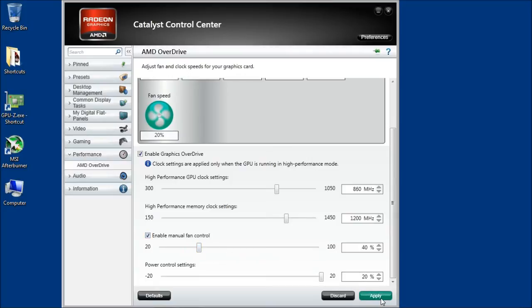The first thing we are going to do when overclocking is give more voltage through our power setting control, so the video card will be stable when adjusting GPU frequency and video memory frequency and will have enough voltage to do so. The next thing we are going to manipulate is the GPU frequency values by adjusting them in plus 10 MHz steps. This is my law when I'm overclocking video cards. Adjust your GPU clock by plus 10 MHz steps and then test it.